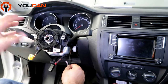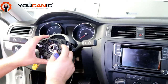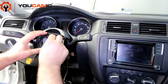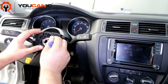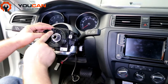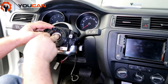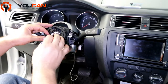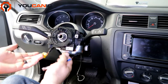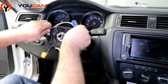The most important thing to keep in mind: not only do you want to mark the steering wheel position, but this clock spring — it's good to put some tape over it so it's not rotating or moving, staying in the exact same position. You don't want to spin this around. If you spin it, when you start driving you can stretch the ribbon inside the box too much and break it. Also, if you put tape, you might get away without having to do a steering angle calibration.